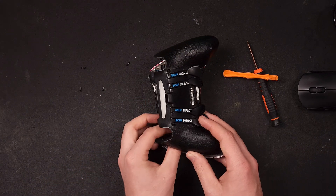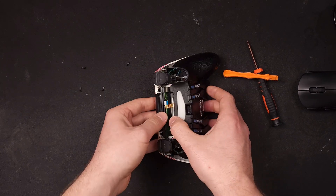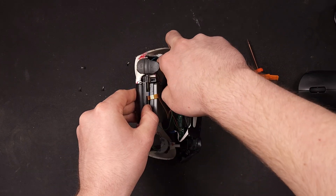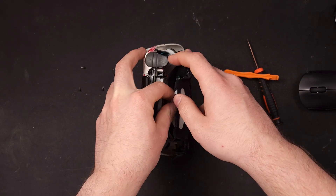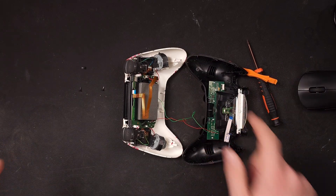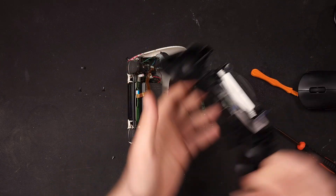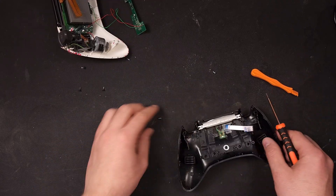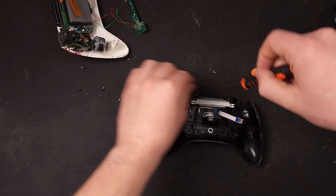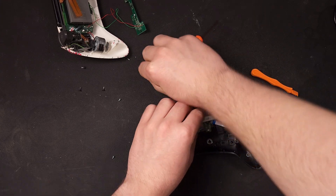Once the two sides of the controller are separated, be very careful and separate them until you can see the ribbon cable inside and pull it out of the main board of the controller. My controller has a couple extra wires and ribbon cables that connect the front and the back case together, but yours shouldn't — these are specific to my controller because they connect the back paddles to the main board. Now that you have the front and the back separated, disregard the top half as it does not matter for this board install. If you still need to find out what controller model you have, I will link the iFixit teardown in the description. There are two screws you need to remove from the plastic piece holding the front light diffuser in, which will allow you to access the charging board and the other side of the ribbon cable.